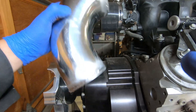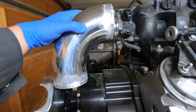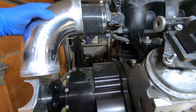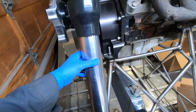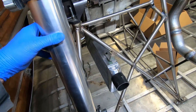I welded a bead on these as well. In this case it's pretty important that the tubing doesn't separate, because I don't want it to come off into the prop. The plan is to bring that down and then over here reduce it from 4 inch to 3 inch and bring it down into the cooler.